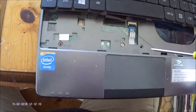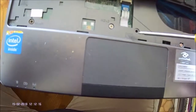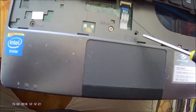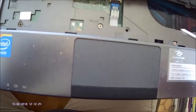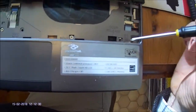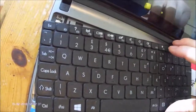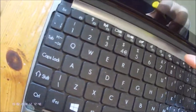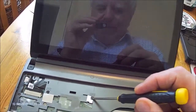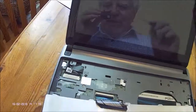The first screw is this one here and it is in fact marked DAW M2 x8 — that I believe is a 2mm Phillips-headed screw, 8mm long. The second screw is by a slot called DAW release, and it is also marked DAW. The remaining three are at the top here, here, and here. So that's five in total.